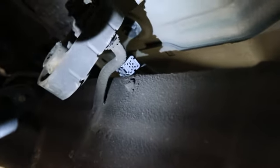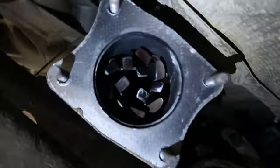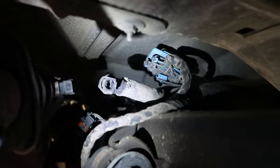There is a plug up here right in front of that one where the bed seam is, where the bed and the cab meets. That's one of your EGT probes. You have another sensor right here, a little bit forward, right? Look at that craziness. What the hell is the point of that? There's a few more EGT sensors up here, and then you have your main harness for your urea tank, which is right there, that needs to be unplugged. You have your injector plug, which is just right there, and then you have one more sensor right there that needs to be unplugged, and then you can remove all of this junk.